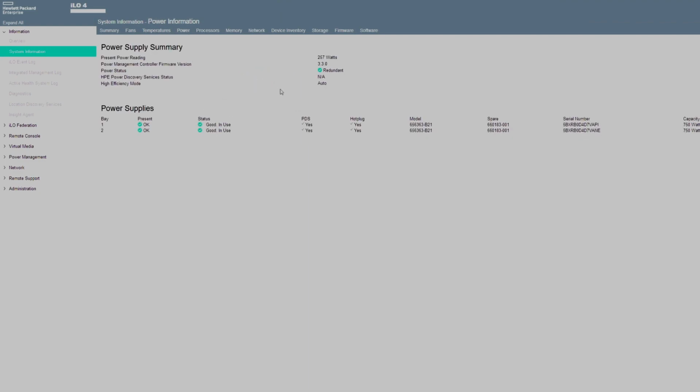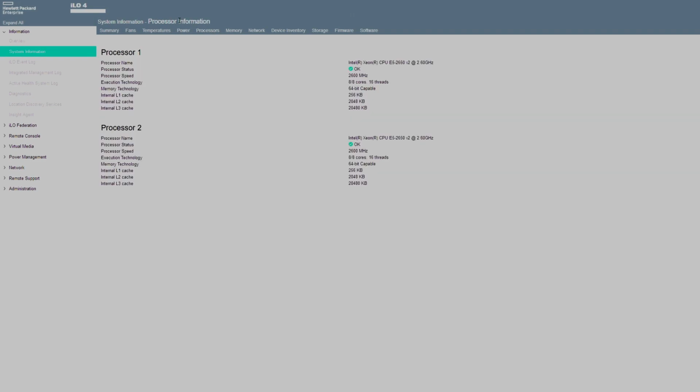So I went for fairly low power CPUs for this server. At the moment it's currently using 257 watts. It has redundant power still. They're both 750 watt power supplies, so if one dies, the other one's still there. We won't lose power. And it is also hooked up to a UPS, uninterruptible power supply. So even if it did lose power, it should still be able to power itself through one of the power supplies on the UPS, hopefully. I don't know if it can actually hold the full load that is required. It might only last a couple of minutes, but power cuts here usually don't last very long, and they're very rare anyway, so that's fine by me, I guess.